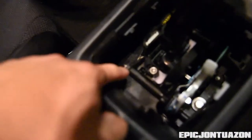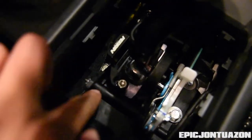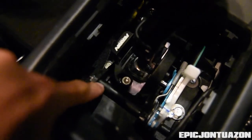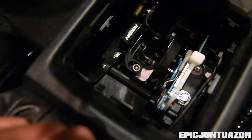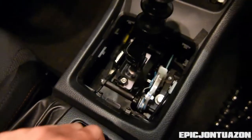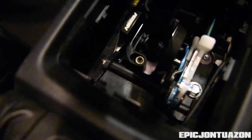Okay, so you cannot use a ratchet open socket to remove these little screws here to put the washers in. The point of having the washers is to reduce the gap between here and here. And so you can't use an open-ended socket. So we're going to do a Lowe's run to pick up a 7mm open wrench. For all your tool needs, you can always go to Lowe's. So Lowe's, you owe me one.